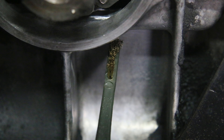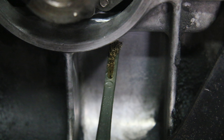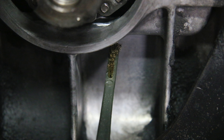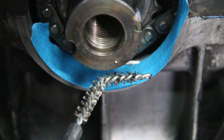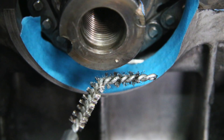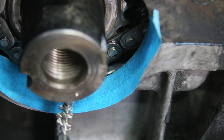I used a brass brush to get the whole area around that hole as clean as possible. Remember, you have oil that's probably absorbed into those pores in the aluminum casting, so you've got to get all that cleaned out. In the end I needed to fabricate a heavy-duty rough brush — I bent and sharpened it so I could get down underneath that timing chain and into that groove.